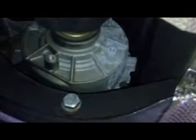And I got now to the transfer case. Now I'm going to have to take the mount out, and I'm going to have to support the transmission while I'm taking it out. I took the flex disc off over here and disconnected it already. I've got to find out how to move the back drive shaft so I can pull the transfer case this way. It might go down and then I might be able to push it backward. Here, let me show you another.